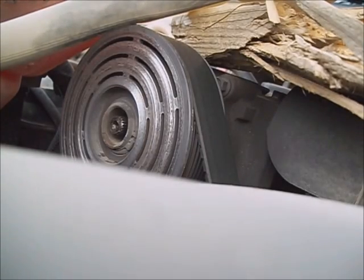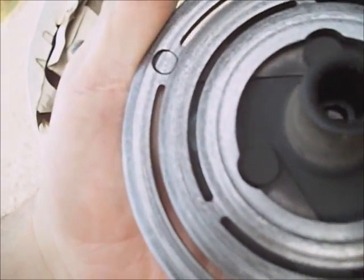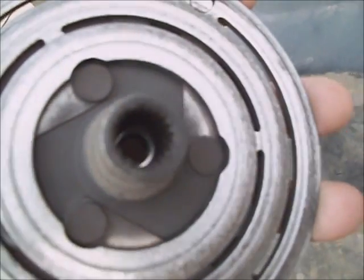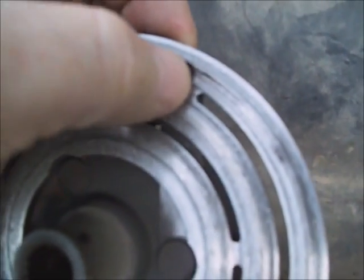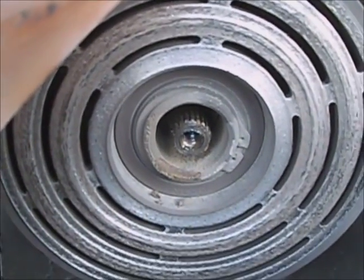Keep your splines facing up as you take it off, in case the washers don't fall out — keep the washers from falling out. I'm going to take a pick and pick the washers out. There's one washer down in there. If it acts up again, usually when it's worn into these pins, it's pretty much about done — but I ought to get a little more life out of it.